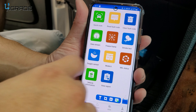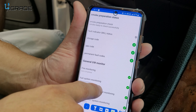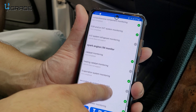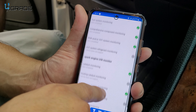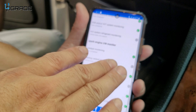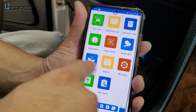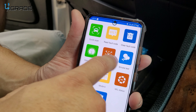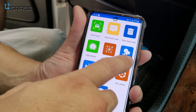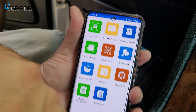This is a great feature — if you're not ready for a smog check, you can go in and check smog readiness. Right now we're okay on pretty much everything. Nothing is in red, so we're in a good spot. You can always pre-test your car before taking it in for a smog check. There are many options: data stream, freeze frame — you can take screenshots — and default reset codes, though we don't have any right now.